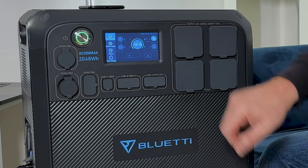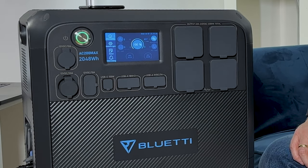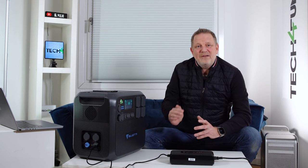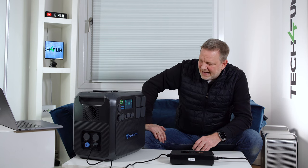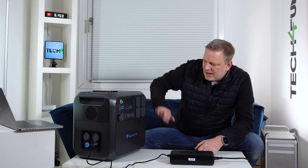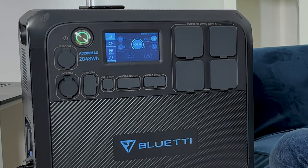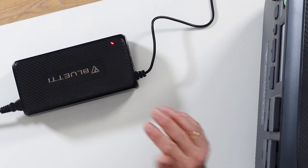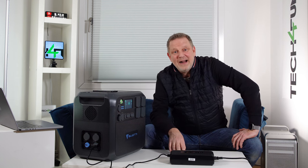The touch display is very simple and clear — it shows the battery is at 66% and currently charging at 457 watts. The BMS manages how much power is drawn: when the battery is relatively empty, it pulls close to the full 500 watts; as it fills up, the wattage tapers off. Currently reading 453 to 463 watts — very interesting. For solar, you can charge in parallel: 500 watts via the mains charger and up to 900 watts via solar panels simultaneously, giving about 1400 watts total.